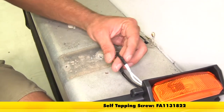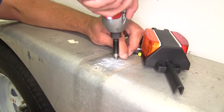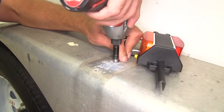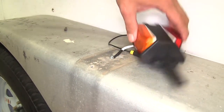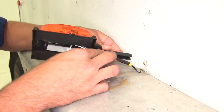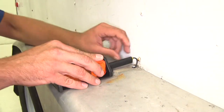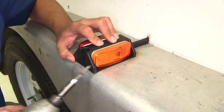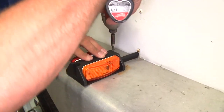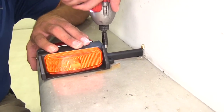For our ground wire, we're just going to use a quarter-inch self-tapping screw. Once that's installed, you'll want to tuck your wires — you can see the slots here — get those tucked right in there so we can keep them nice and hidden. Since our light doesn't come with any hardware, you'll want to reuse what you had on your trailer or provide your own.